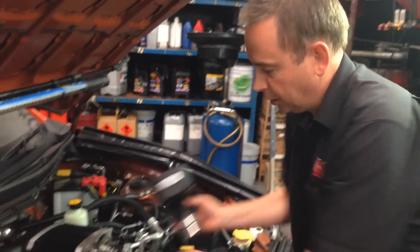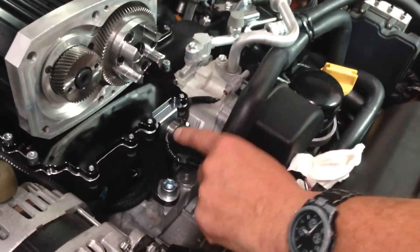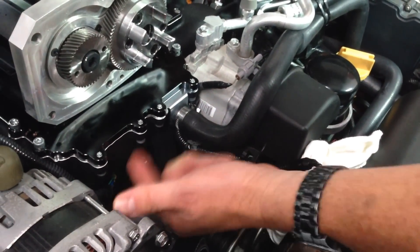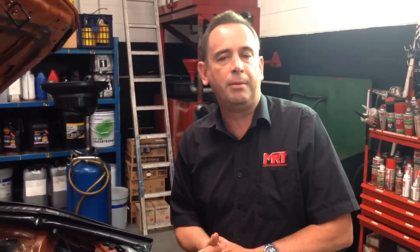These kits are absolutely fantastic. Remember, here in Australia it's fitted with a charge cooler that sits down here. This is actually the water supply outlet pipe and inlet pipe for the heat exchanger that sits in here. It runs down through a water pump to a little radiator at the front of the engine, giving it a little bit more grunt but evenly distributing the air in the inlet manifold to give more reliable performance.